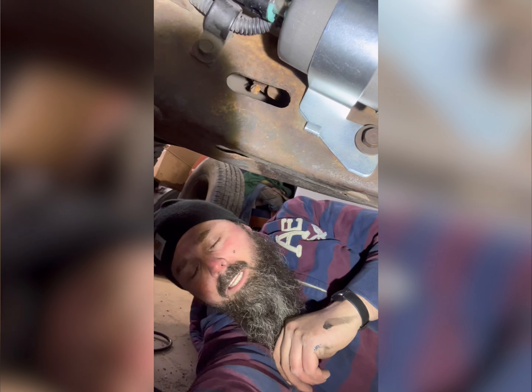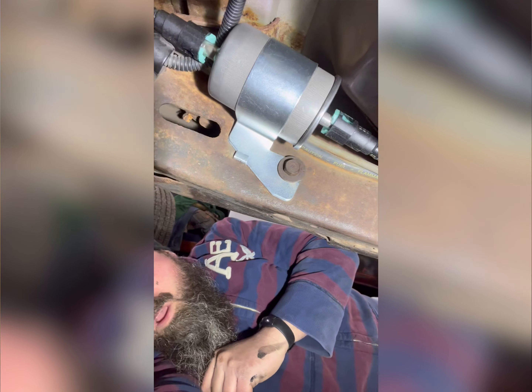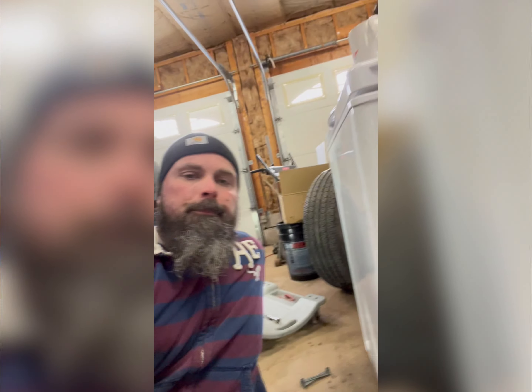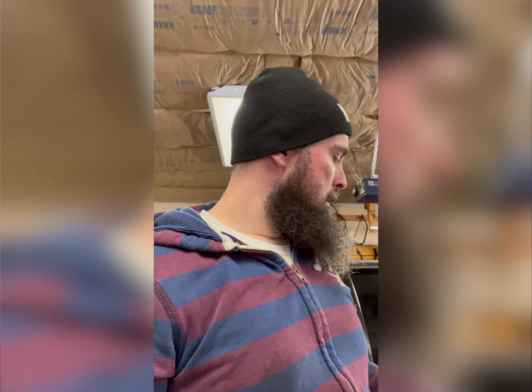Now that it's changed out - I did spill a little bit but it's okay, that's what dripped out of the old one. Fuel lines are hooked back up on the tank, got the wire hooked back up. Now we should probably test it out and make sure we don't have any leaks. By the way, if you guys spilled any fuel and you're in an enclosed area, the fumes are flammable - don't blow yourselves up. You just don't want sparks with fuel fumes around.